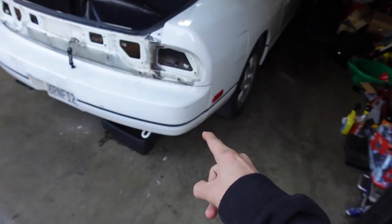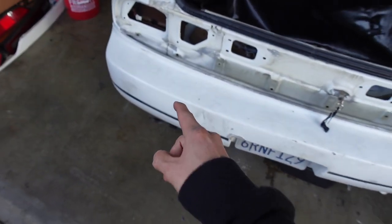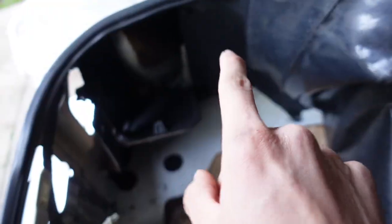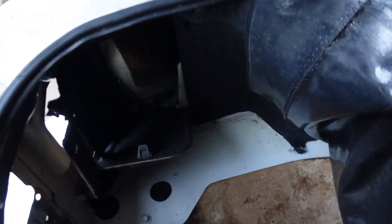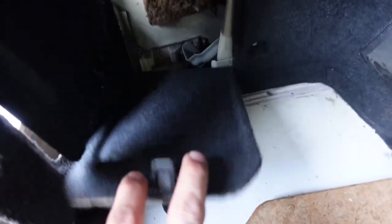I'm going to show you guys how to take the rear bumper off before I time lapse it, because when I was taking off the black hatch bumper I couldn't find any videos on how to do it. My black hatch doesn't even have this interior, so it was a lot easier. There's a bolt right underneath that connection — there are three bolts. You can't miss them — one, two, and then there's a third one all the way at the bottom.